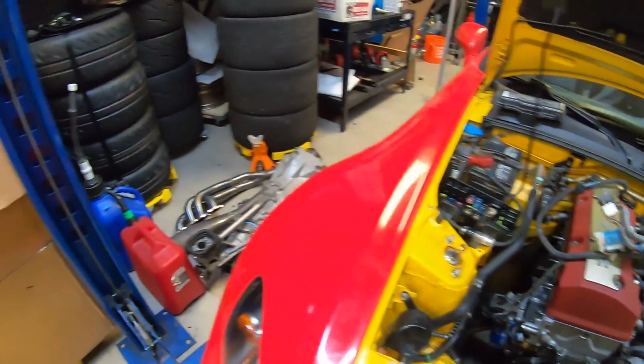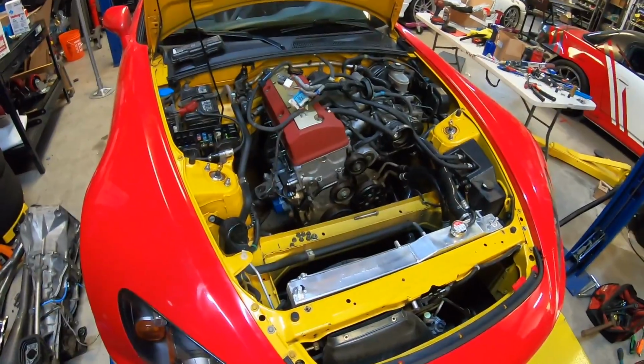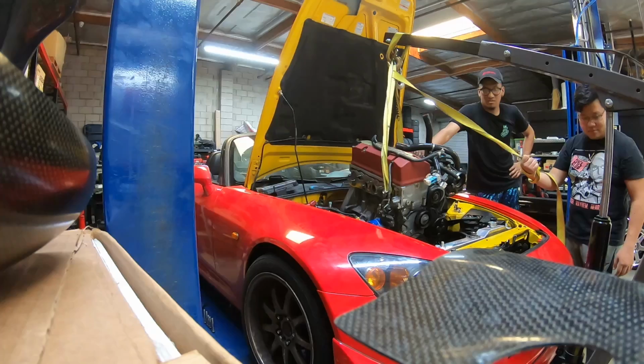It's been a couple days. Decided to take a break and take things slow. It's progressing today. We're gonna get the motor out, get it on a stand, to get the teardown started. Got the harness out, got the trans, driveshaft, exhaust, all of that out. Today we're gonna drain the radiator, pull the clutch and flywheel, disconnect the fuel lines, pop her out. Motor's almost out.